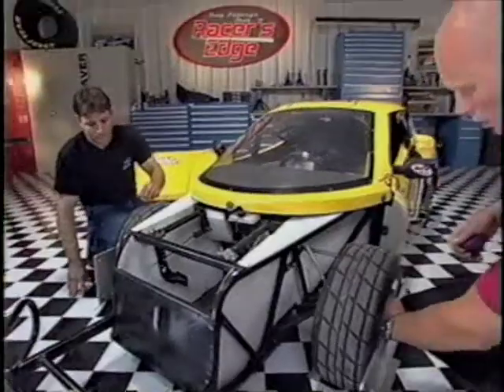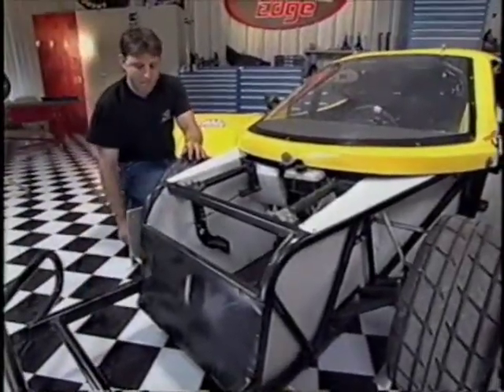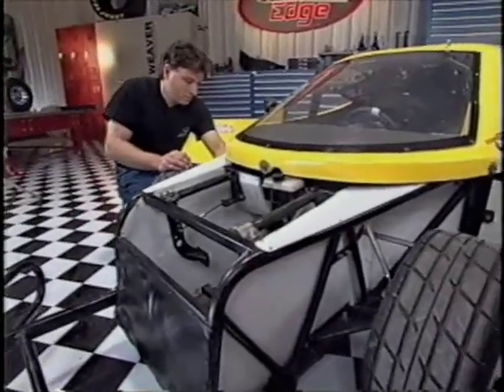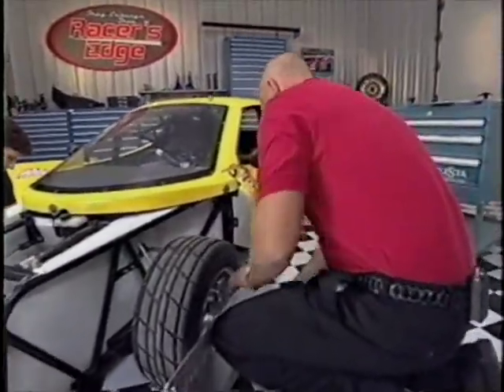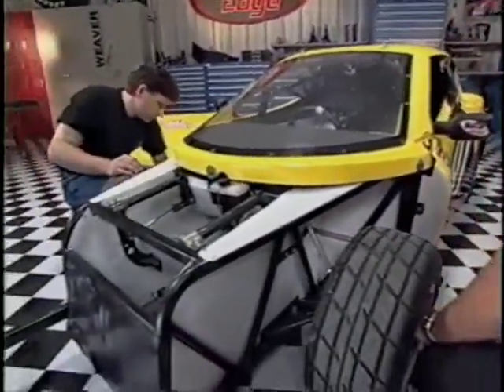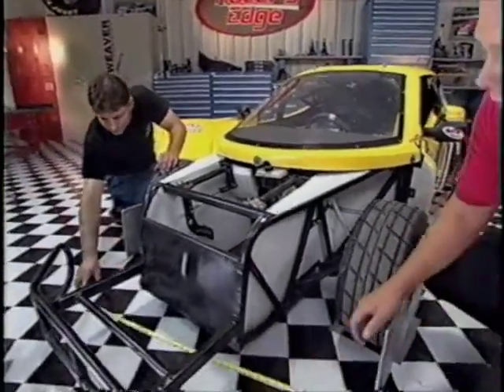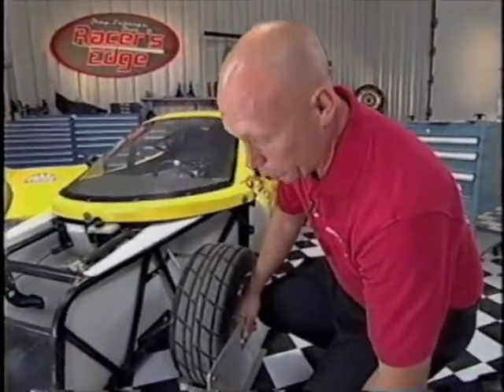We're probably going to need about another 16th of an inch on that. Let's check it here in the front — give me another 16th on that. Make sure the vehicle settles real good. Okay, I'm liking that. What we're doing here is making sure that we have a 16th to an eighth of an inch of toe out, and that's exactly what we have — an eighth of an inch of toe. That's really going to help you get down the straightaway, get into that corner, and give you that secure feeling without a lot of wandering.